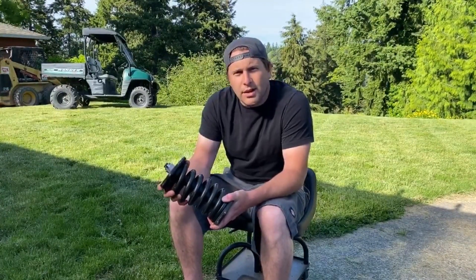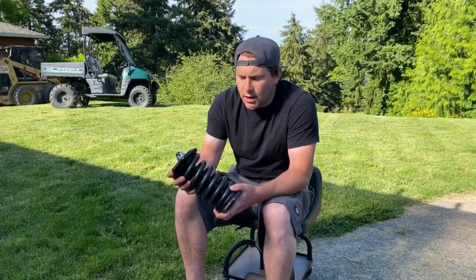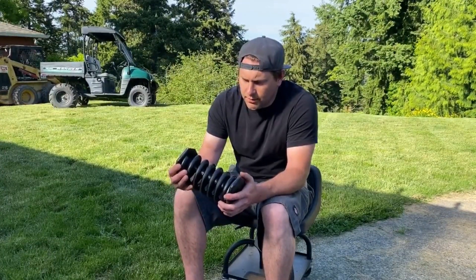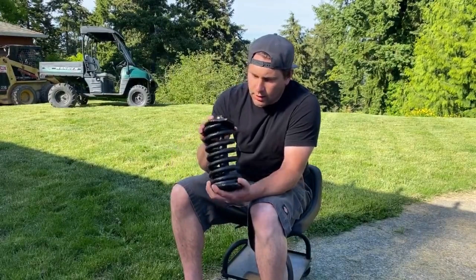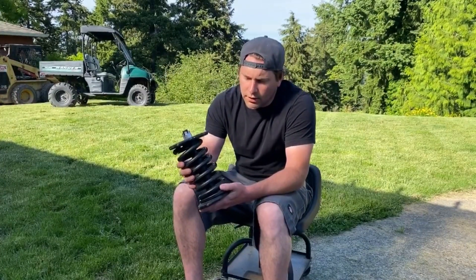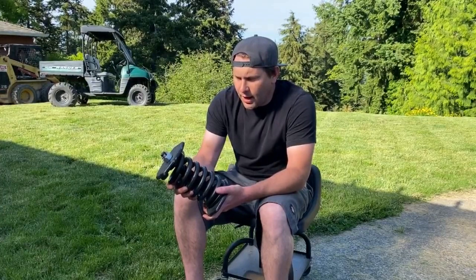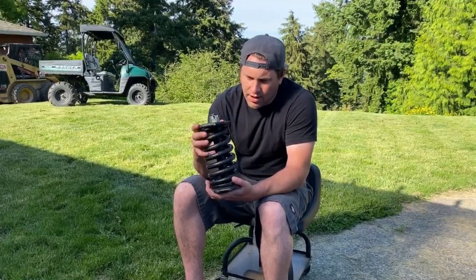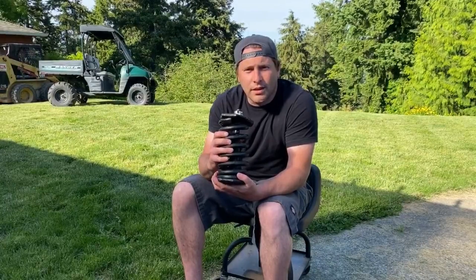So I just started looking for springs that were around the same dimensions, and I ended up finding that 2019 Toyota Tacoma springs were the same size in dimensions and wire gauge. They were a little longer, so I had to cut them down to make them fit. I had to guess the travel size — they're a little wonky — but I test fit them and they're gonna fit. I ended up spending $20 for these springs on OfferUp, so all in all I'd probably have forty dollars into repairing these.